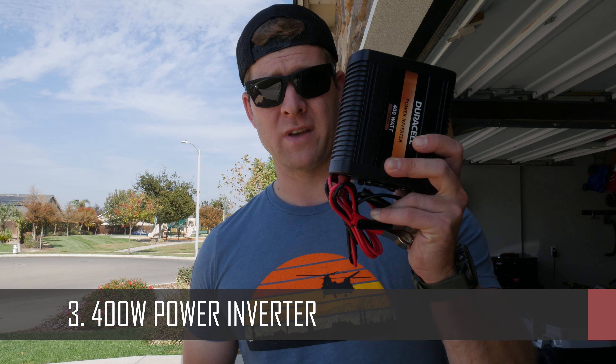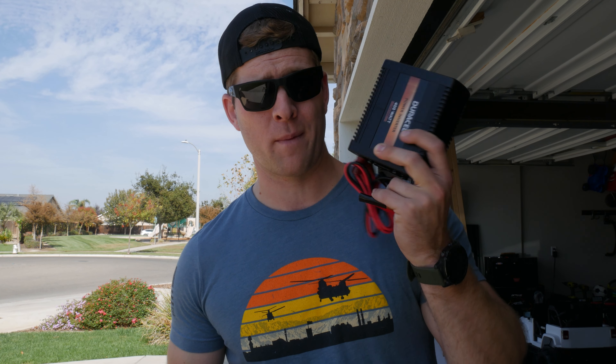Well, that didn't work at all. The AC adapter here can charge at over 200 watts, and the outlet in the Jeep is only rated for 150, so it tripped before it even started charging — we'll call test number two a bust. That is however a great segue into test number three: we're going to use a 400-watt Duracell inverter. I bought this at Advanced Auto Parts for about 60 bucks, and now we'll see what kind of charge we get.